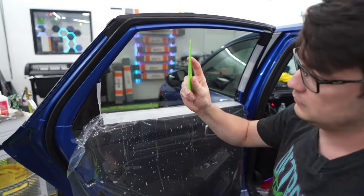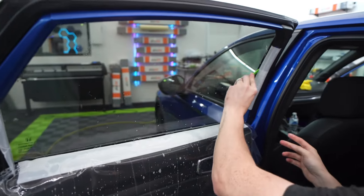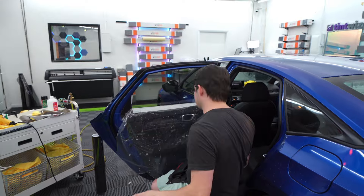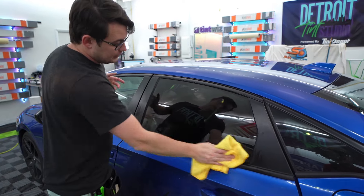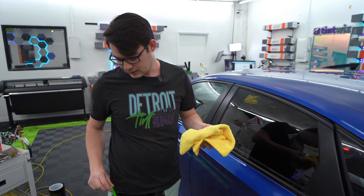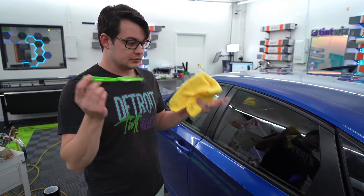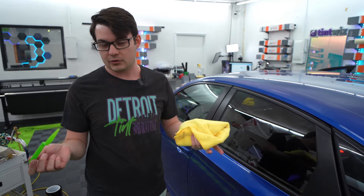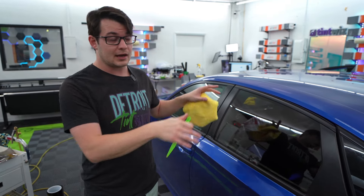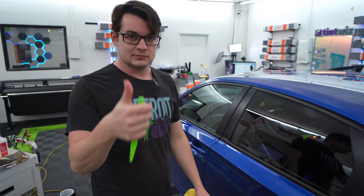Then use the swiping edge tool — the Tri-Edge — to swipe all those edges, and that's it. From there you just wipe it off and check over your work to see how it turned out. Tinting a door window doesn't require very many tools, but having the exact right tool will make your job far easier. These are all the basic categories I recommend — make sure you have something for each one, especially when tinting regularly. If you have any comments or questions, leave them below. Thanks for watching.